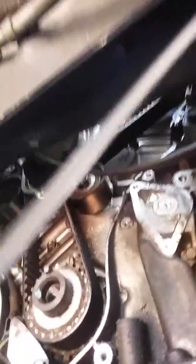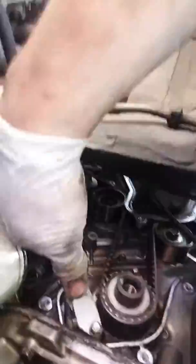For you guys who have never been inside one of these bad boys, you can see we're looking at our timing belt, we're on our crank sprocket here, idler, tensioner for the timing, and then both cams for the dual overhead cam setup.